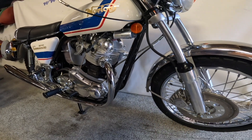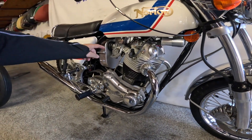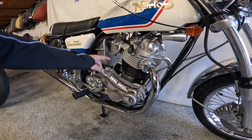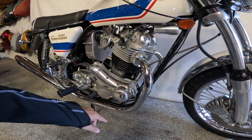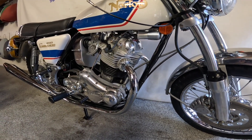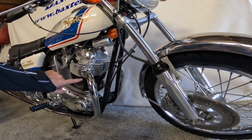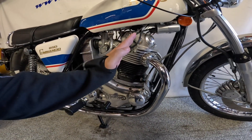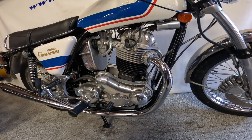We saw a little bit of this bike a week or so ago — just a clip, it was up on the stand getting worked on. Looks like concentric carburetors, a pair of those. Overhead valves, cams are down here, points are under this cover here, and here's a mechanical tach drive. I just love this kind of thing — this is really a king of it all. It's got a little slant forward to the engine compared to the Atlas, which had the more vertical configuration and was also 750cc.